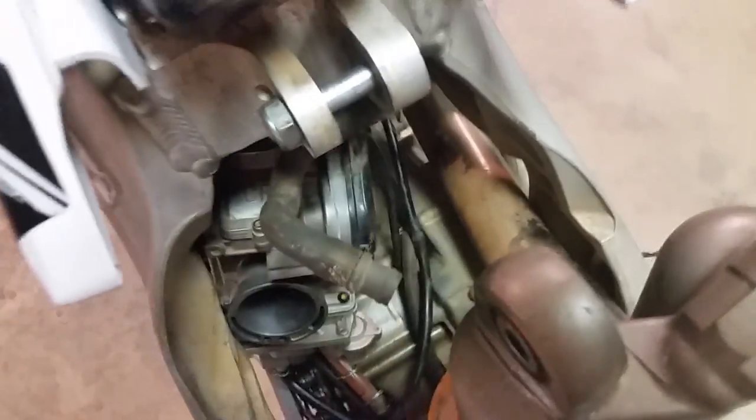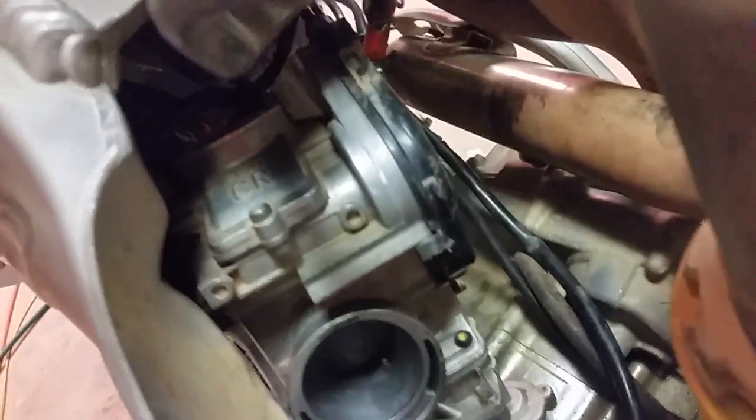Now that I've removed that top shock bolt right there — whenever you remove that, I recommend taking off the nut and then picking up on the back tire. If it's not sitting with the back tire off the ground, I recommend taking the weight off. If it's not on a stand, it's going to fall down, so make sure you have a stand under it. That's the top bolt out, and I've threaded those bolts back in. Now I'm going to take the throttle linkage off. There's a little throttle cable, and there's one Allen screw right there — this cover should come off pretty easily. I recommend wiping off all the dirt around here before you take that out.